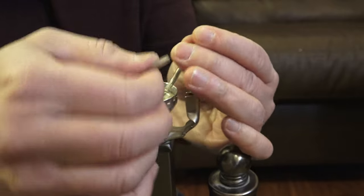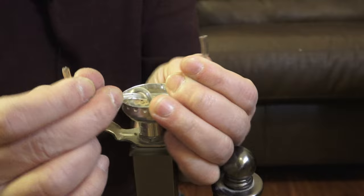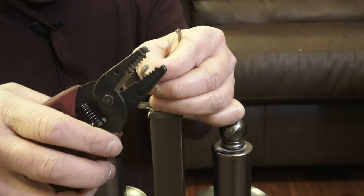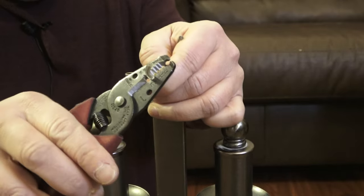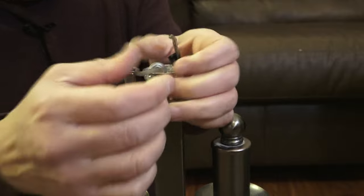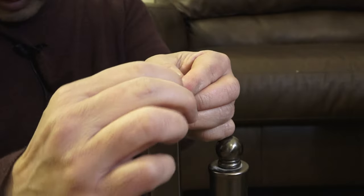I'm going to follow my live wire and reattach my marker so I know where the live wire is. Once you tie the knot, you want to strip off about half an inch of the wires. You want to consolidate the strands so it becomes one piece instead of a whole bunch of strands. Do the same thing on the other wire — consolidated like so. Now you have two pieces sticking out.